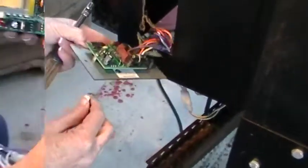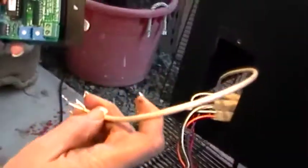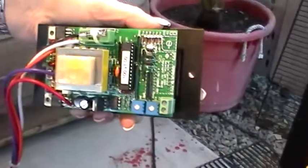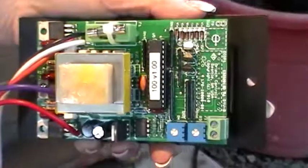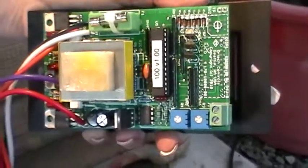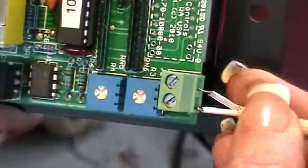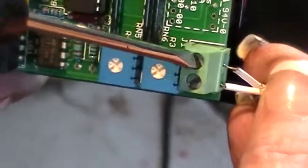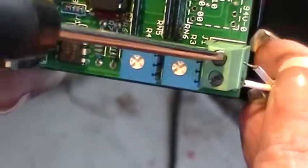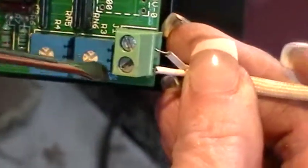So you gently just feed it out, pull the probe out through the access panel. The old control is hanging. Now we're going to take the two leads off the probe and put them into the back of the circuit board. This is very important — I've seen people do this and come back and say their digital control isn't working, that they can't get any temperature readings. Well, if you don't hook up the temperature probe, you're not going to get any readings. Patty's got the wires into the connector. I'm just going to reach over with the screwdriver and tighten it down. You don't need to really crank this — just finger tight. It's kind of a small screw, not a whole lot of torque.